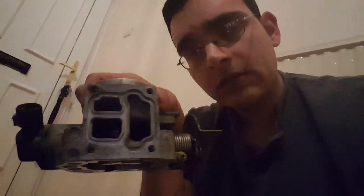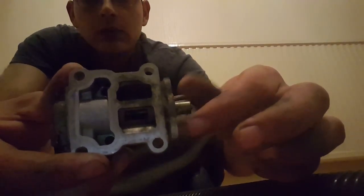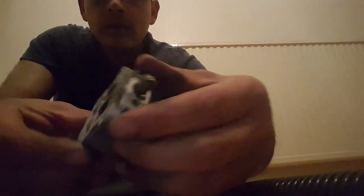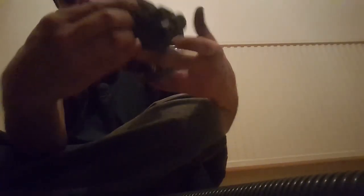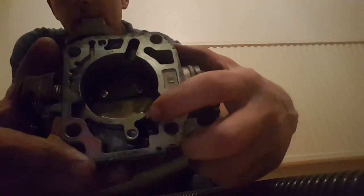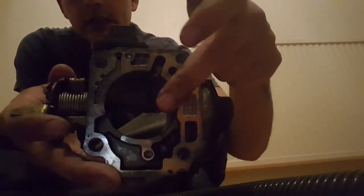Just clean that out where the carbon goes, carbon build-up. Clean your idle control valve out because you'll find that it will stick open — it should move freely like it is now. So what you gotta do: spray carb cleaner in here, all in here and in here. Clean that out so it moves freely. Use a cloth, microfiber cloth, whatever you want to use. Then where it sits on the housing of the throttle body, clean up there, in there, in here as well, and in here. Remember: open the butterfly, clean all inside the throttle body, clean the edge of the butterfly — top and in there.